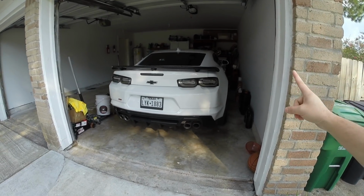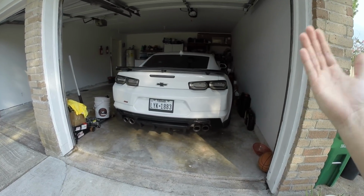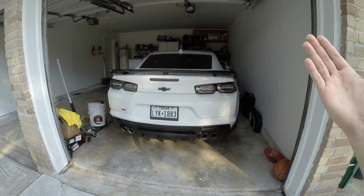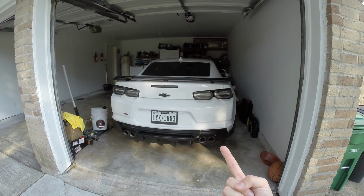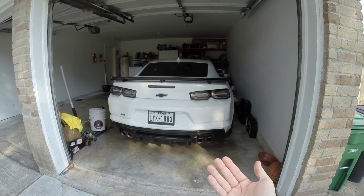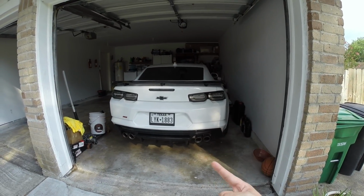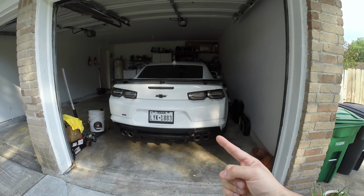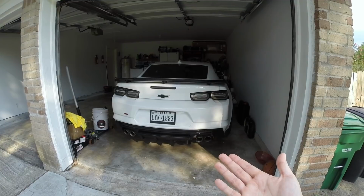Unfortunately, you can't just add E85 to the fuel tank and expect to get those gains. You can only get those gains if you have the appropriate E85 flex fuel sensor, which basically reads out how much alcohol content is in the fuel, and the appropriate tune that has the flex fuel sensor enabled and E85 tables set up properly.